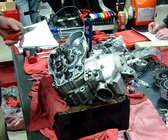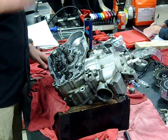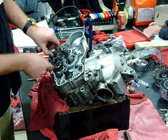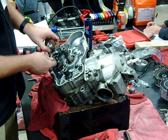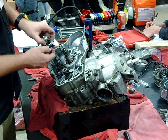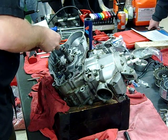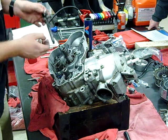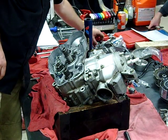I've got another snap ring — I want to go with that idler gear because I know that could give me a problem. Now I have enough stuff removed where I can pull my shift shaft off. This is what was wrong: the guys that installed this last time didn't have this in here right. Remember how I was having a hard time finding neutral? They didn't have a spring hooked up in here and it just kind of fell apart on me. The spring itself is broke — it's definitely no good now.